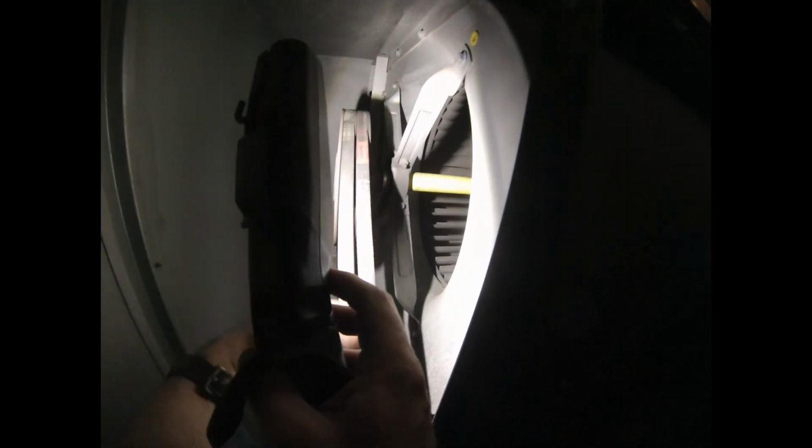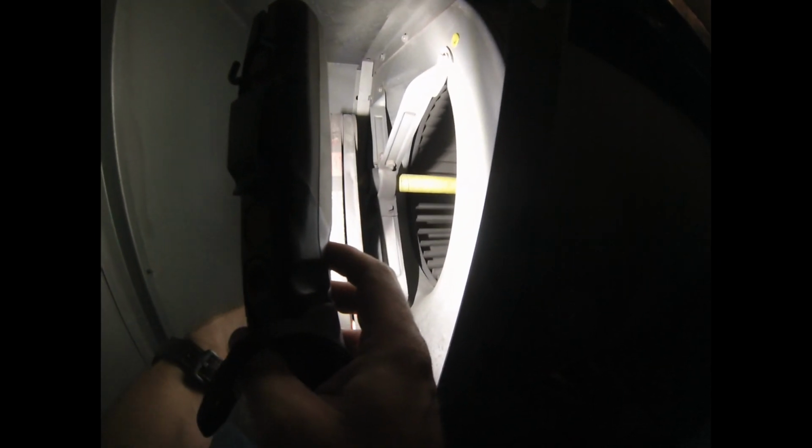And then if we come around here, if you can see, we actually want to spin it and take a look at the fans inside there, all the blades, make sure none of them are coming loose, there's none missing or nothing weird. When these go out of vibration, it's pretty serious, right? And this should all be very, very easy to turn. It's all on pillow block bearings, and very, very smooth, right? You don't want to feel anything weird, right?